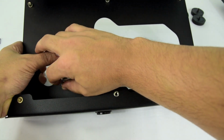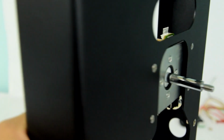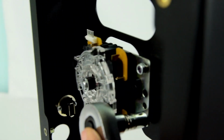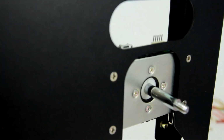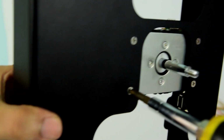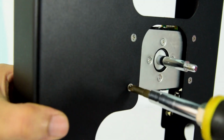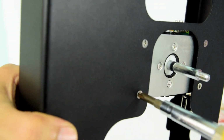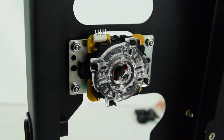Put the 4 8mm nuts back in place, leaving them finger tight. If you use an 8mm wrench or ratchet to hold the nuts in place, you can use your other hand to tighten the Phillips head screws on the other side of the lever mount. All 4 screws need to be tightened pretty securely, but take care not to exert so much force that you strip out the heads on the screws. Patience is a good thing to exhibit here. No one wants to replace hardware. When everything is good and tight, you should be left with something that hopefully looks a little like this.